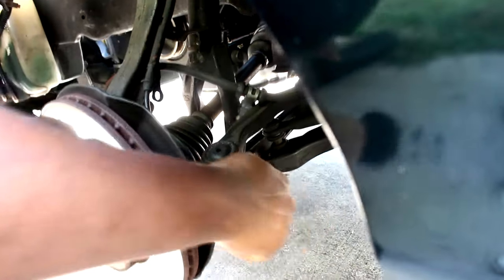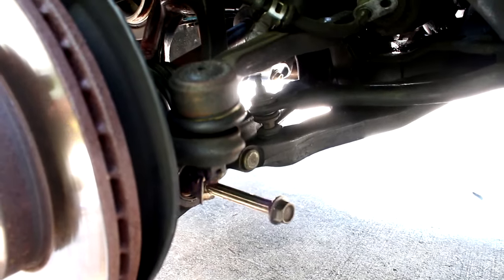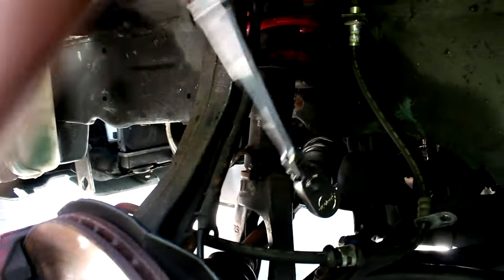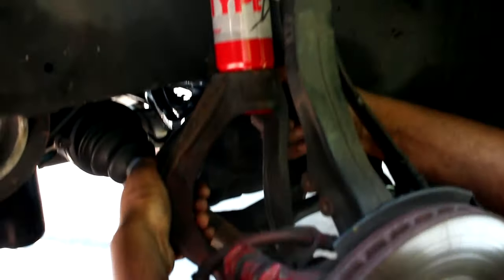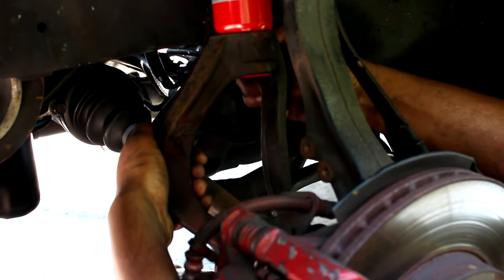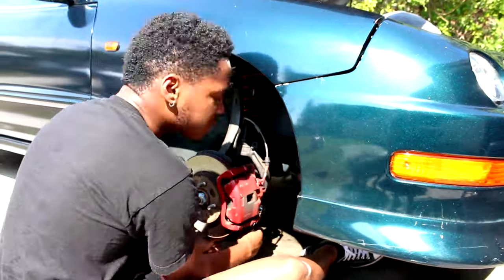For the process of removing the fork from the coilover itself, you want to remove just the long 17 bolt at the bottom. There's a nut on the other side of it. Yeah, a hammer and a screwdriver works as well. And there goes that. We're going to remove a 14 millimeter bolt at the top on the fork itself. Randy got his side almost in. Now it's just a matter of putting the fork onto the suspension itself. And he got it. So his side's pretty much done. Now I'm going to finish up my side and get that coilover installed.